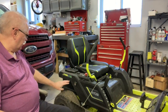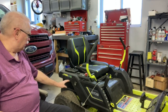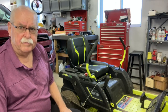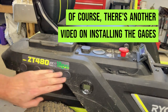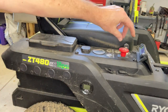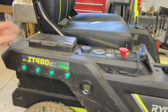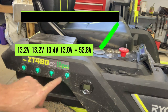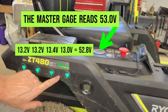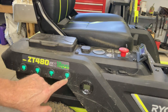The first thing I'm going to do is turn the key on. With the setup I have, I can check the four individual battery voltages. I've got four volt gauges on here, one per battery. I turn the key to auxiliary and that shows me the voltage in each of the batteries. Last year this one was always the lowest and this one was always the highest — and it looks like it's still doing that, down just a couple of tenths of a volt.